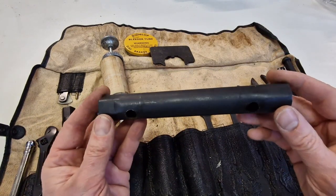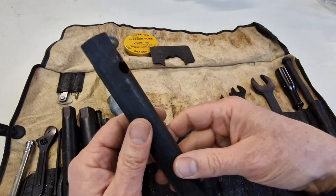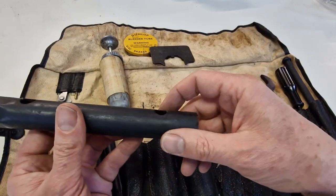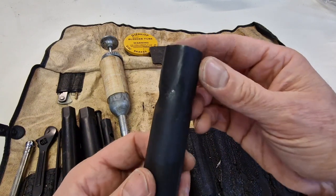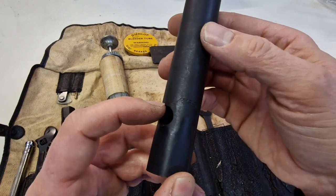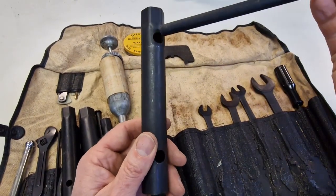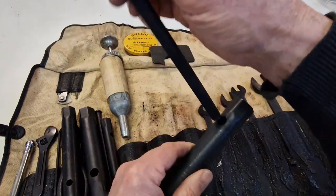Then we have the 7-inch box spanner. This is end marked, and here you see this one is the 3/4 AF. This is for the cylinder head dome nuts. I wonder how you get that on and off, it was just by hand and the larger Tommy bar. And the other one is 1.5. Where is it? Ah, there it is. It is BSF, and this is a half BSF. This is for the spark plug, really. And you get that out with the larger Tommy bar, so you get that in here. And with that tool, you should replace the spark plugs or tighten the cylinder head. Funny thing, eh?